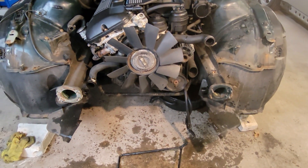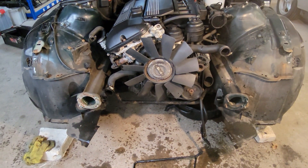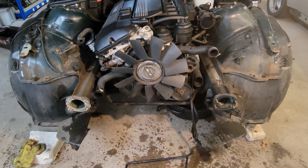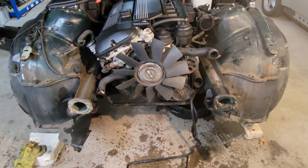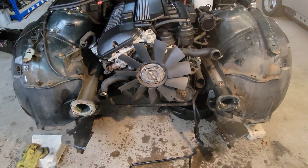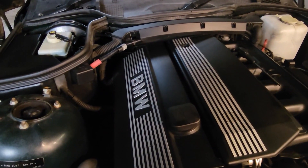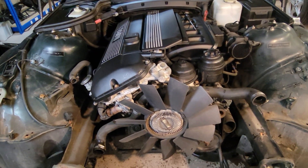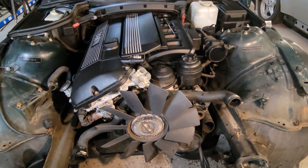So next time, once this is fully drained of coolant, disconnect the power steering, get that out of the way, go around the engine and start taking off any other ancillaries that make sense - like the power steering pump, the alternator. Disconnect the exhaust - I'll probably have to jack the car up a bit higher to do that comfortably. Maybe even disconnect the gearbox as well at the back. My plan is to pull engine and gearbox out as one. I've got lifting points out here - I'm hoping there's something similar at the back. This engine, 100,000 miles or so, seems to be in really really good shape, at least cosmetically. So next time: strip a load more stuff off, disconnect the exhaust, maybe disconnect the gearbox, and get ready to lift it out.